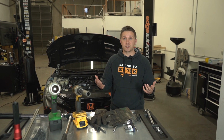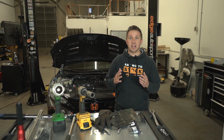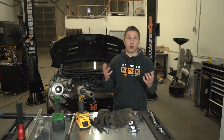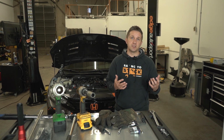It's got a lot of stuff built in that makes it easier to drive from the factory for any given person buying the vehicle. There's a delay valve in the slave cylinder that almost prevents the clutch from engaging really quickly and abruptly, like you'd want in a performance application, to make it more comfortable on the road. There's also a diaphragm inside the master cylinder that absorbs some vibration and doesn't transfer as much fluid through the clutch system to the throwout bearing as a performance application should.